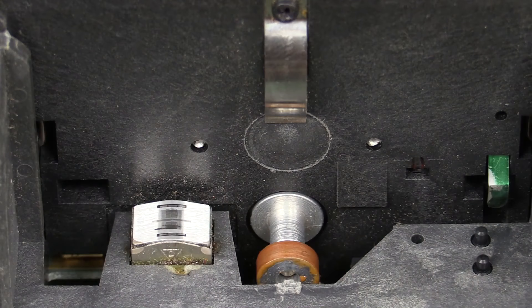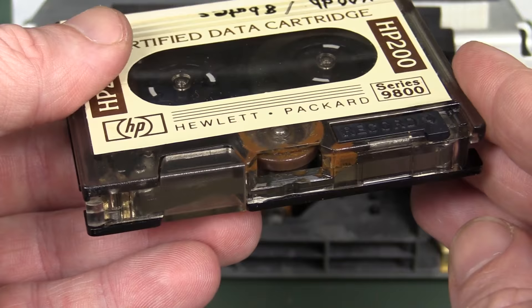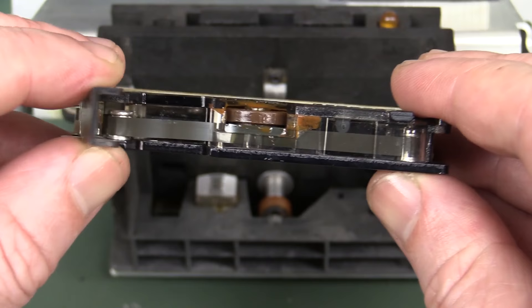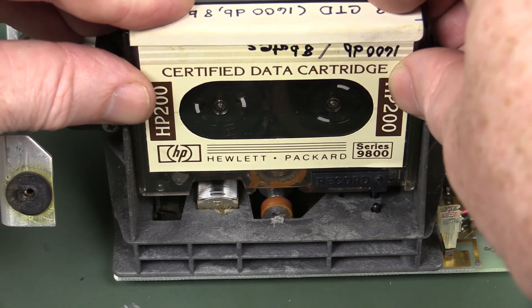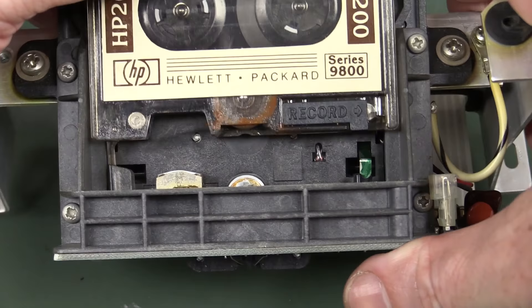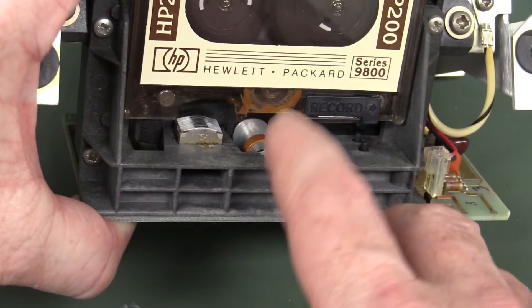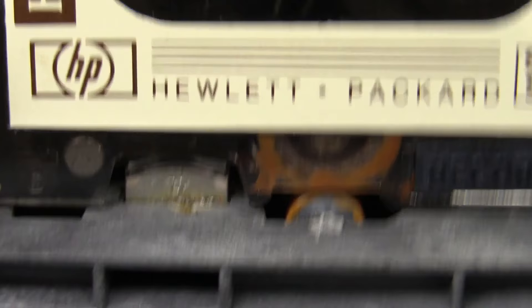The roller mechanism is really good. Unlike a cassette tape, there's no drive on the individual spools. They've got a little spindle in there that drives the tape. The tape is on the bottom half and the spindle is on the top half. When that slides in, it just flips open — beautiful. It goes in like that, the tape goes across the tape head, and the little capstan wheel drives the tape. You might be able to see the tape just pushed over the head.